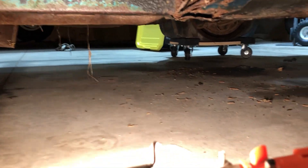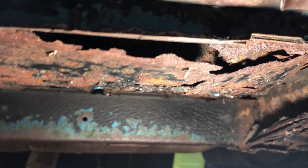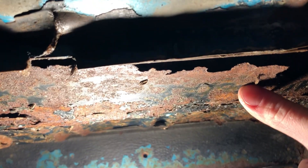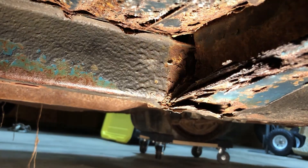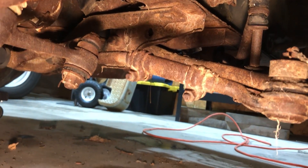Now for the worst of the rust I can see so far — this torque box is all rusty and crusty. The passenger floor is all rusted; you can see through to the carpet on the inside. The frame rail right here looks good though. Once we get further into this area we'll find out more, but the front frame rail does look good. This tie rod doesn't look like it's supposed to be bent like that.